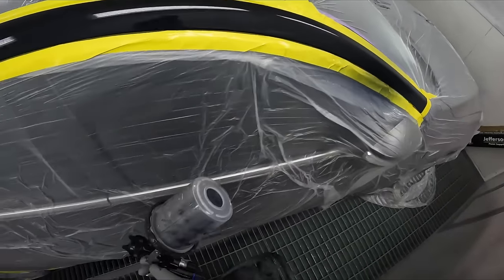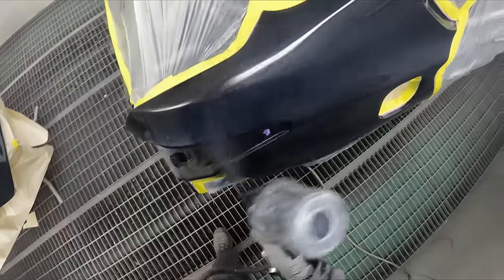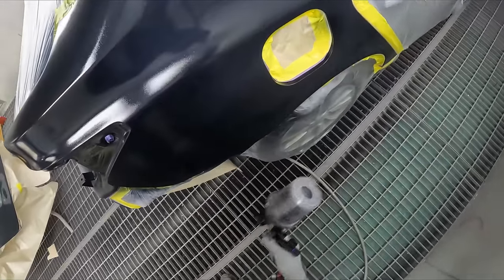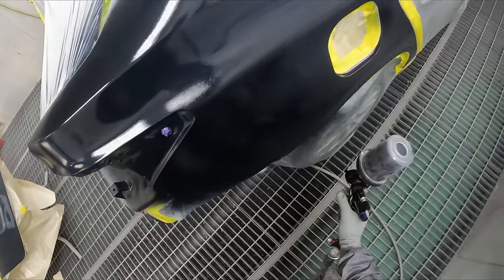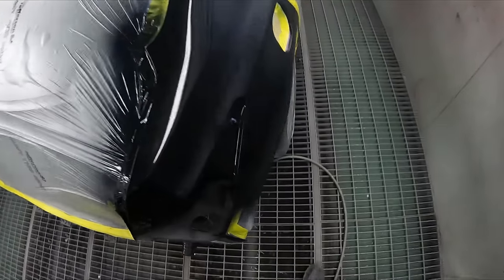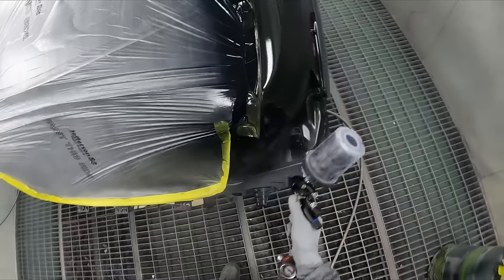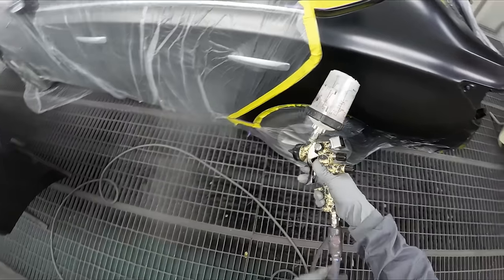To be honest I actually prefer it to the Pro Lights because it's got a bigger fan. I find that the drop coat is easier to put on with the Standox Blue just having that larger fan. Speed is actually an issue with Standox Blue — basically the worst thing that can happen is having the base coat drying as you're applying it, or even having the base coat blender drying as you're spraying, more so on light metallic colors but you still don't want it on any color. Having an ultra-fast gun is quite advantageous.